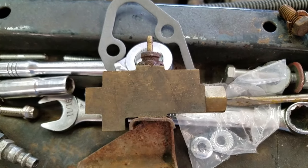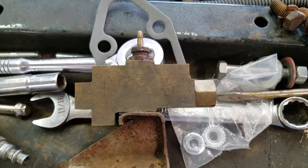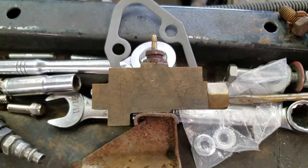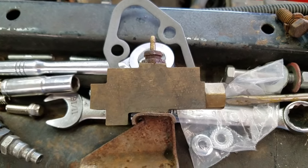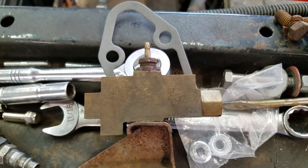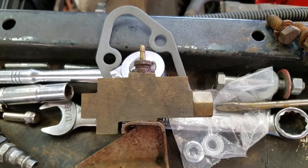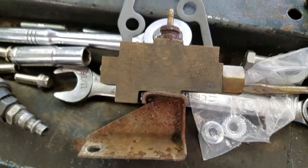So the question is, how do you get it back? The method I've always been told online — if you go on the forums — is you open up your front bleeders or rear bleeders, whatever side still works, open both bleeders up and stomp on the pedal. I've never gotten that to work successfully. My method's a little bit different; there are two ways you can go about it.